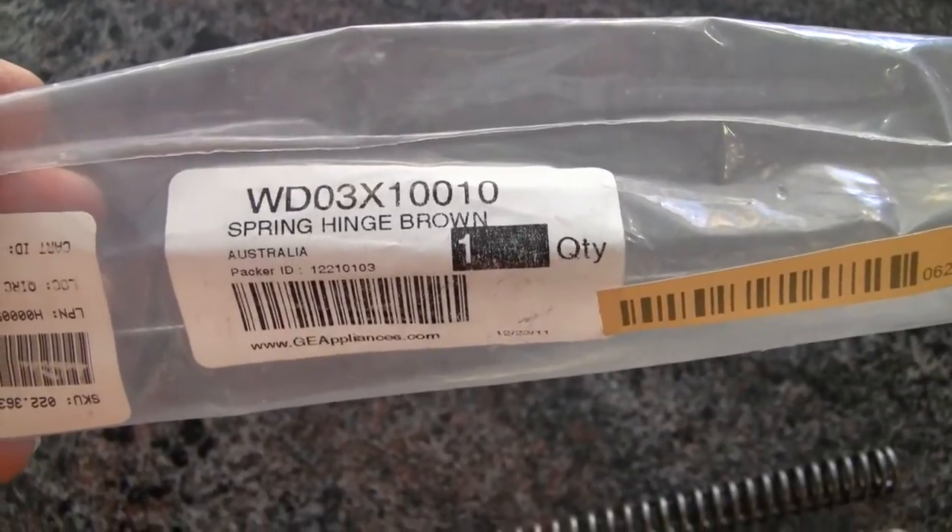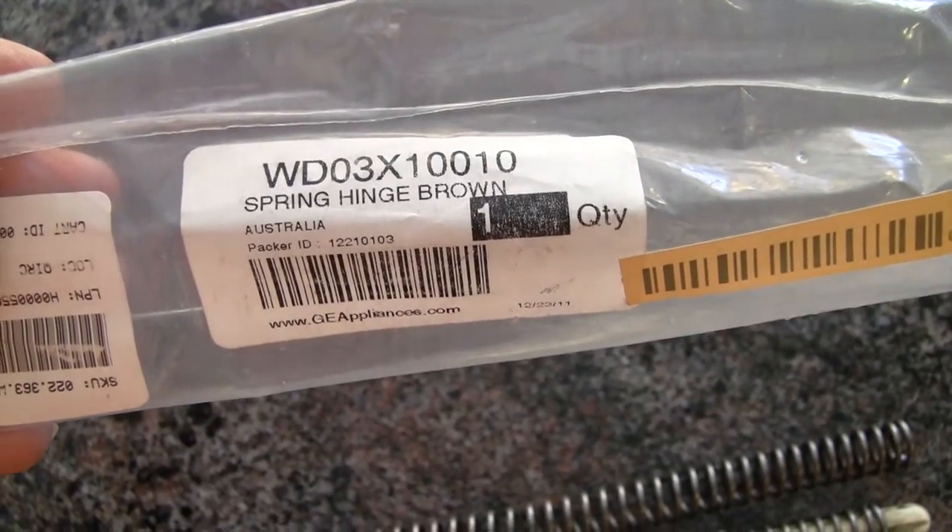Which is another comment I'd like to make. The spring gets compressed after a while and it doesn't provide enough spring force to hold this bracket up, and then the whole hinge falls apart inside and you have to pull it out and get a new spring. So here's the part number for the spring you need to fix this.